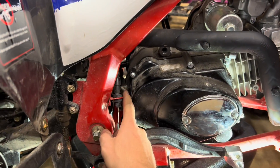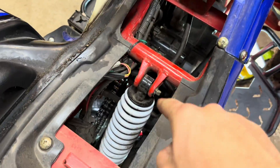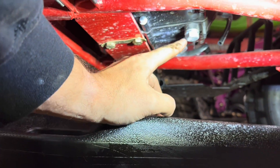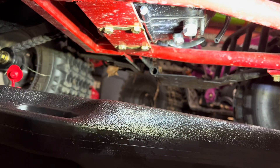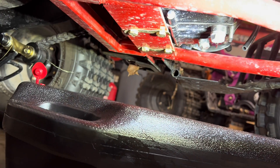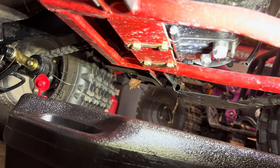Now we're moving on to the oil change. The oil check tube and dipstick is right here — you can get your hand back there pretty easily to unscrew it, and you should have easy access from the top to fill it. For draining, the manual mentions engine oil and something about a separate case. I can see two drain bolts down here — one is 17 millimeter and one is 14 millimeter. I think the 17 is the engine oil. On the other side there may be a fill point for the transmission, but the manual says it takes the same 15w40 oil as the engine.